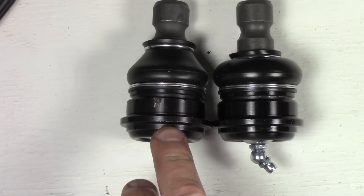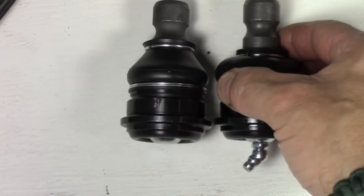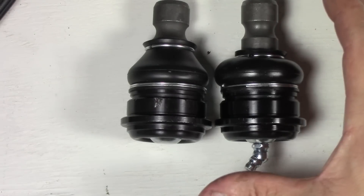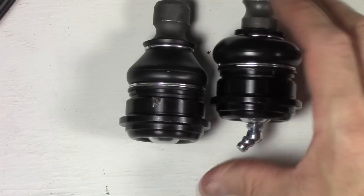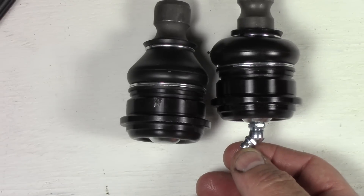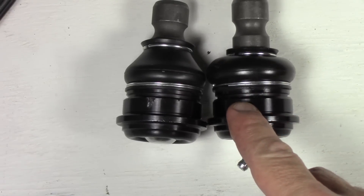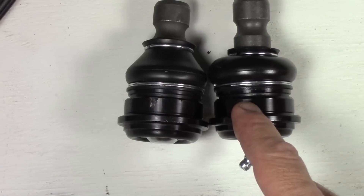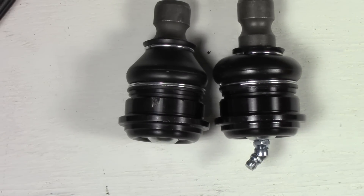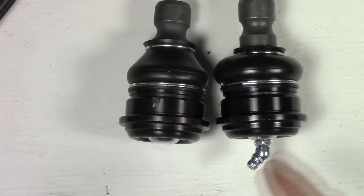Here's a comparison of the two ball joints. The one on the left has not been modified yet and the one on the right has been fully modified with the Zerk grease fitting and actual grease inside the rubber boot — it's a little spongy, but I know it's full of grease. I'll be doing the same to the other one. Make sure when you mount this on the car that the grease fitting is facing in the right direction so you can put the grease gun on it while the wheel is still on the car. I'll be making a video on how to mount these on the Hyundai Santa Fe 2003, covering the 2001 to 2006 models since they share the same ball joints. All the links will be in the video description. Thank you very much for watching — if this helped you out, click the like button and subscribe to the channel.